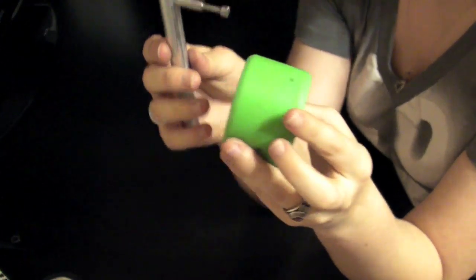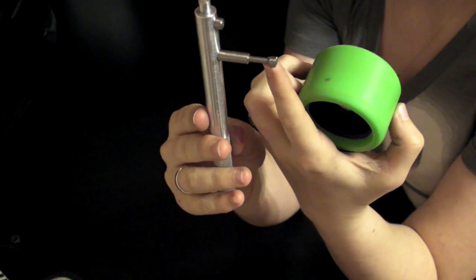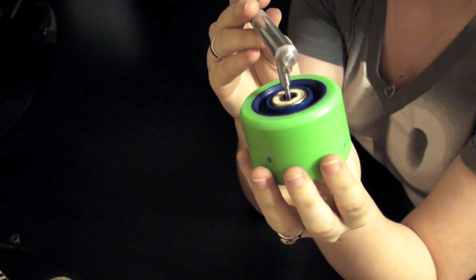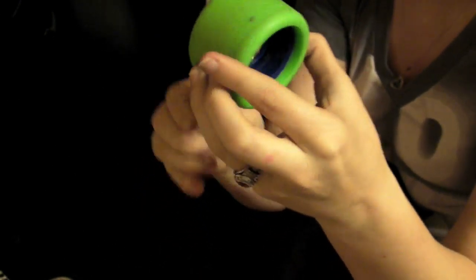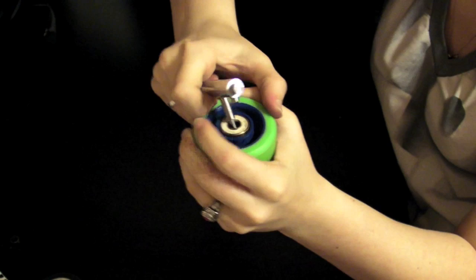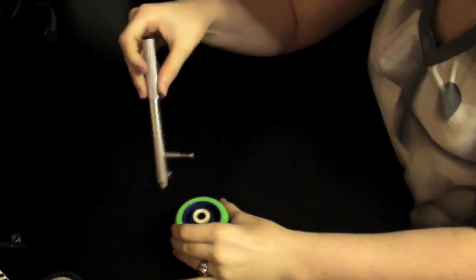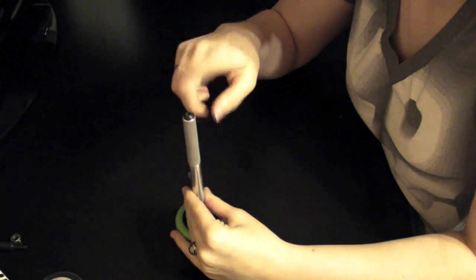When using the Bearing Buddy, stick it in between the two bearings in the wheel — right about in here. This little part will catch on the inside of the bearing; you can hear it catching. If it goes all the way in and you can see it catching the other bearing on the other side, that's too far. Have it in just to where it catches on just this one bearing. With the plastic hub, rock it out just like you did with the Reflex Utilatool. To put it back in, hand press it in a little bit, sit it on a flat surface, press it in, or use a hammer and tap it in.